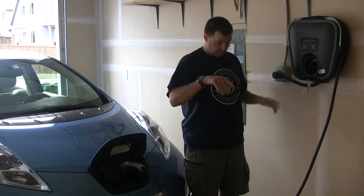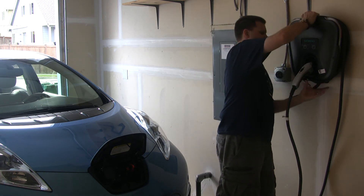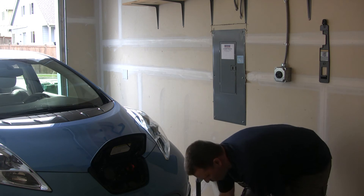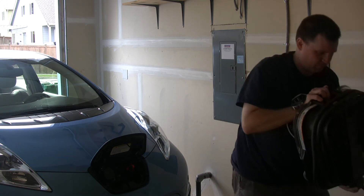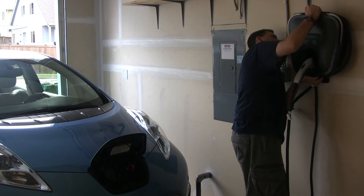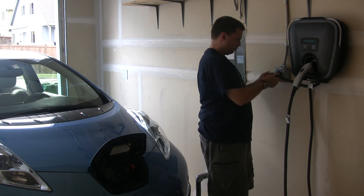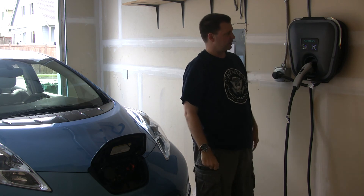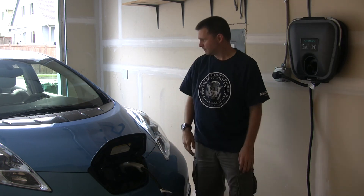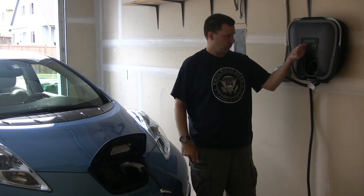One final time, I'll put the new charger back in. This is the new one — no sticker on it. Plugging it back in and watching all the lights come on as it resets. Plugging into the Leaf — beep, thunk, LEDs flashing, and beep beep. Green power light, orange charging light, green halo. Working correctly.